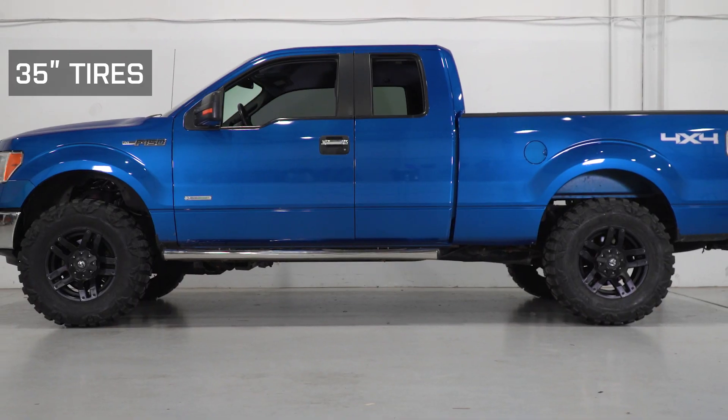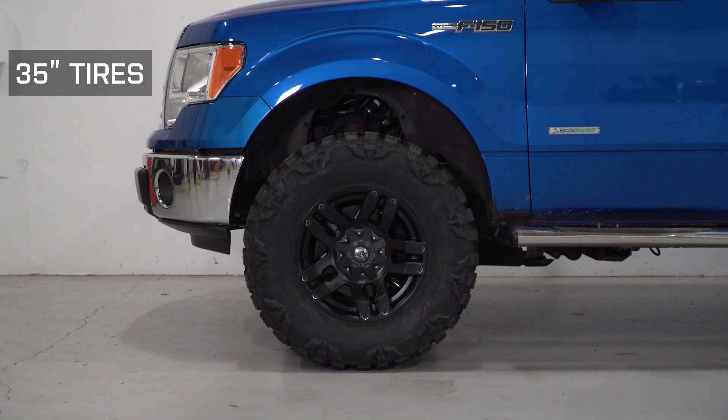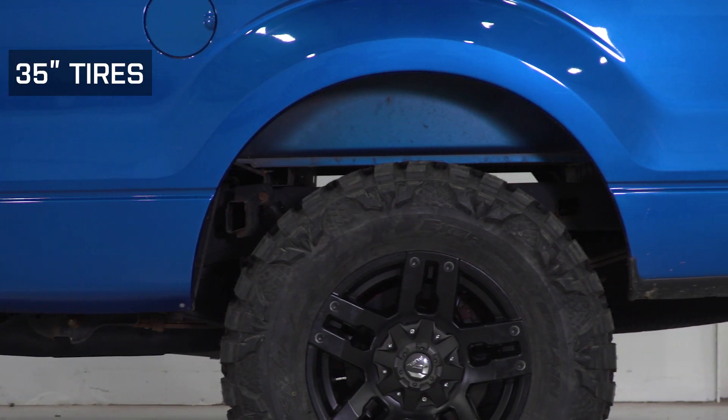Compared to a more involved lift kit that can easily start at a couple hundred bucks — where an install is a lot more involved and you can easily go over a thousand bucks without much effort — two-and-a-half-inch spacers like these still make you more capable off-road. The lift is still relatively modest and doesn't change your CV angles or stock suspension geometry too much, so you should be good for off-roading as long as you're not going crazy with rock crawling.